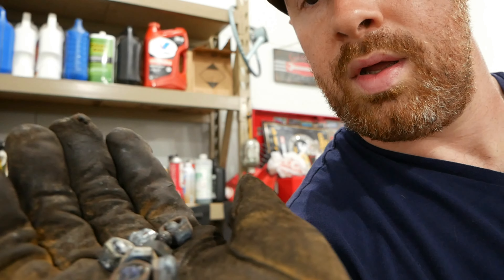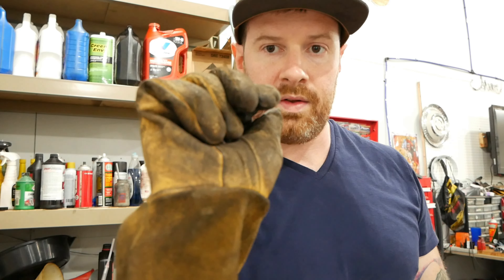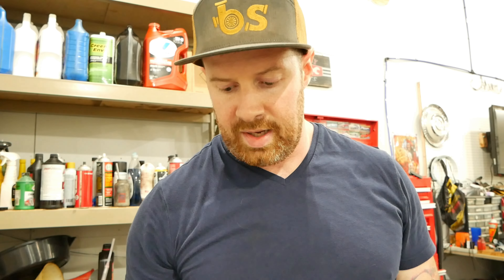This afternoon I came out here to finish welding the downpipe. I tacked it back up yesterday and had it right where I wanted it. Last night I tightened it down to the turbine housing and to the exhaust so it wouldn't move. Today I came out to take the bolts out, get the downpipe off — and wouldn't you know it, I snapped a bolt off in the downpipe. It took me seven tries of welding a nut to it over and over again to finally back it out. I ran a tap through that hole just to chase the threads on it right before I put this together. I don't know what it is with this turbine housing, but I've had nothing but awful luck trying to get bolts to stay in it and thread in it.